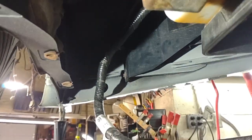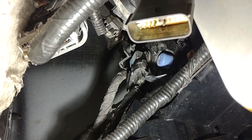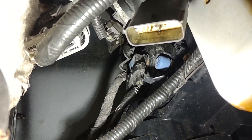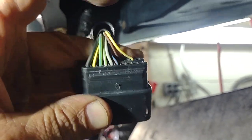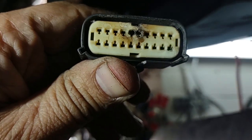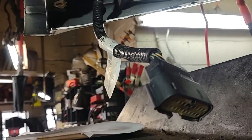I'm going to zoom in inside to show you what's going on. As you can see inside, this is where the short was. One of the pins is cut off — the gray pin for the gray wire is already melted. So this is where the short was. Most likely I'm not going to change the whole harness; I'm just going to cut these wires and bypass them around the harness. And that's it — that's where the short was. Thank you for watching.